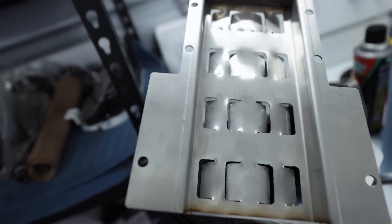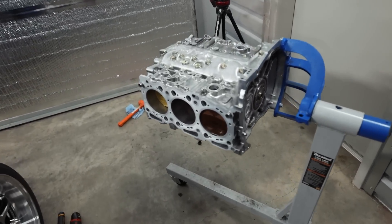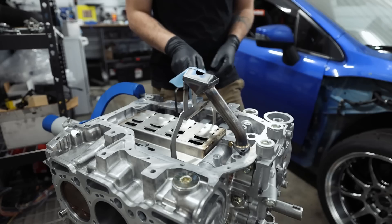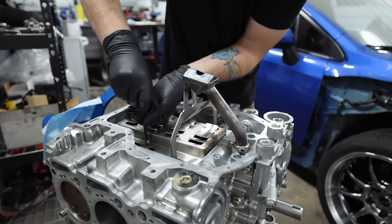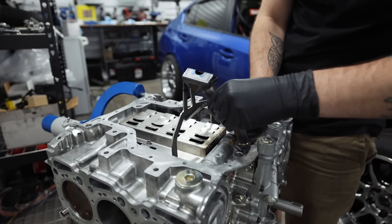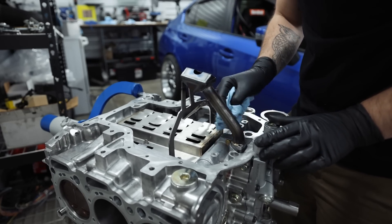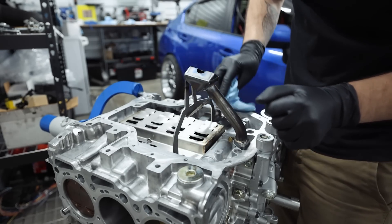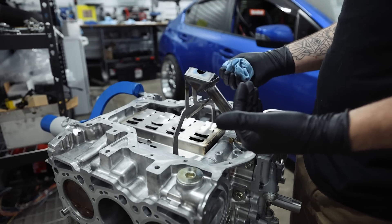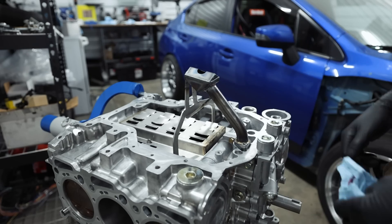What we'll first do is get the baffle on and the pickup on, then go through and put in all of the flapper doors for our oil pan, get it sealed up and get it on the engine. When installing the trap doors, make sure they open to let oil in toward the oil pickup but not out — so it stays closed. Three bond on the mating surface of the pickup. More red loctite. Always wipe up your squeeze-out — way better than our last setup, which was stock. Vast improvements. Everything in here is locked down to ensure nothing vibrates out.